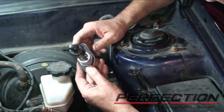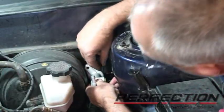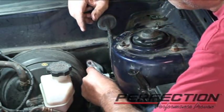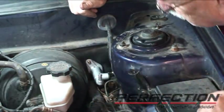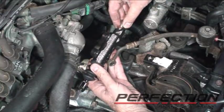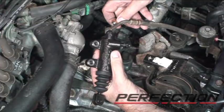To install the master cylinder, there's a foam gasket that I put on — I'm going to leave the plug in for just a minute, put it back through the dashboard, get it lined up, then attach the line, attach the nuts, and put the reservoir back on. This is the new slave cylinder — we've got new copper washers there. We're going to put one copper washer on each side of the fitting, tighten that up, and then we'll start the bleeding process.